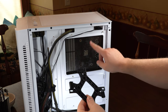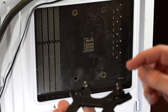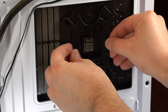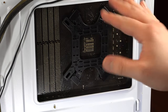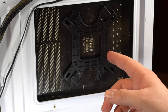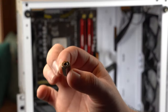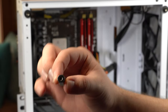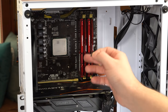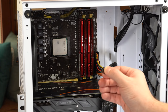The next step is to install the back plate on the back of your motherboard. You see these four holes, and whichever orientation you have the screws, they should just slide right in. If they don't go in or don't go the right way, check back in your manual. Once you have the back plate in, take these little lock nuts — hexagon-shaped nuts — and screw them onto all four of the screws. You want to screw them fairly tight because that's what holds the cooler on the board.